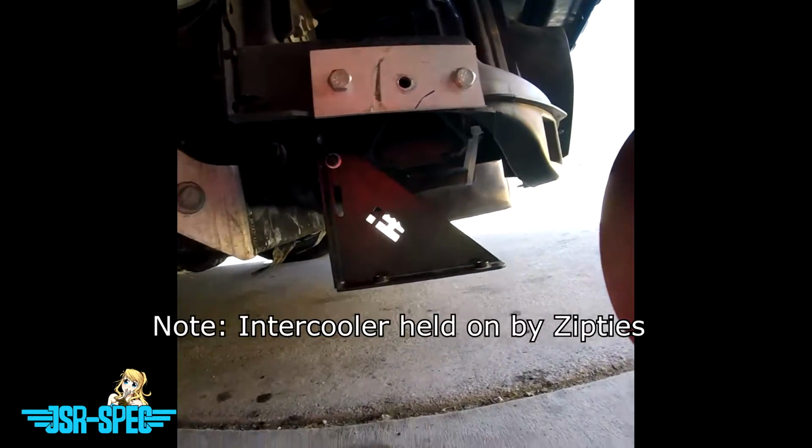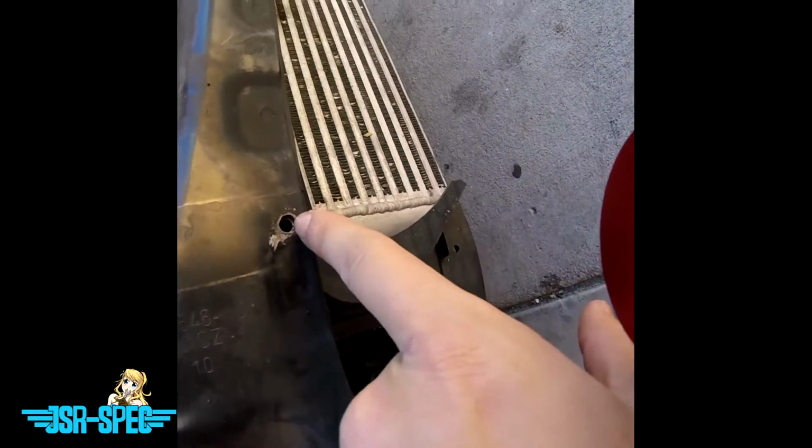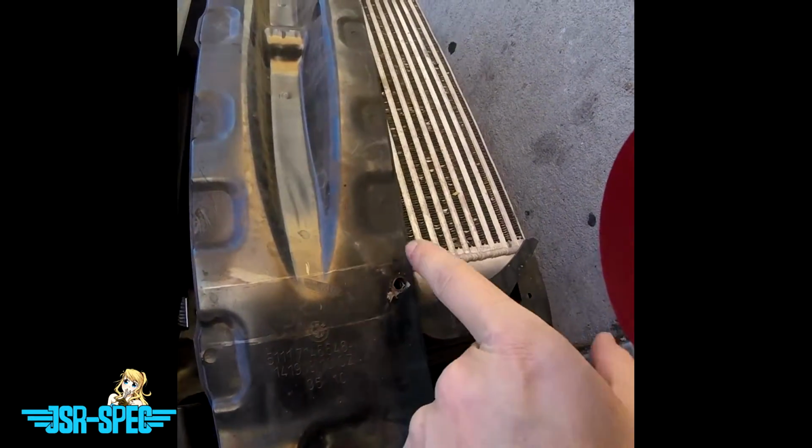So let's go over my mounting real quick. As you can see, that is the Hard Motorsport chassis mount bracket. You can see the 2 holes here. That's where it mounts onto the splitter. It's height adjustable with those 2 little screws up there. This is where the side mounts go into. I made those brackets for another application, but they work for this. And then the front brackets, the front splitter rods, or the front mounting, goes right into the bash rod here